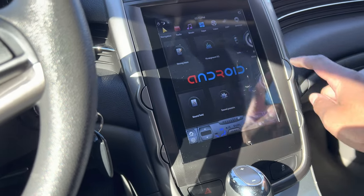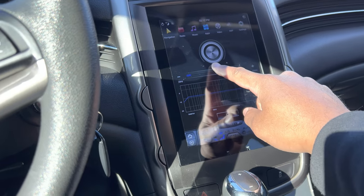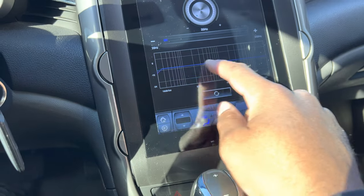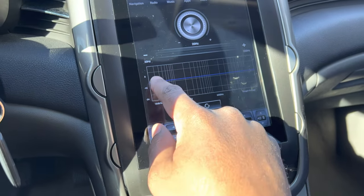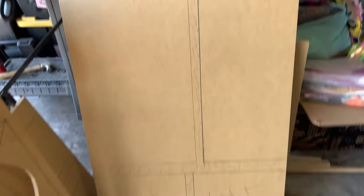Since I have this DSP, I'll go in here, balance off all my door speakers, set my subwoofer gain to zero, and set the EQ completely flat with no curve. I'll make a second video on that. Right now I'm finishing the box for the Monte — I've got all my wood laid out with just a couple more cuts to make. I've got the front and bottom already cut, I'm going to double-baffle the front. I've got the top, back, and sides measured out plus two interior braces. The double-baffle front piece is half-inch and everything else is three-quarter inch. Thanks everybody for rocking with your boy!